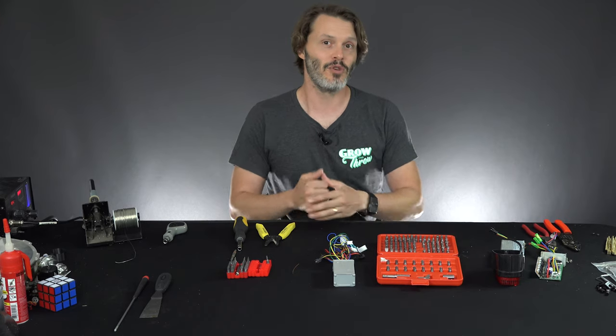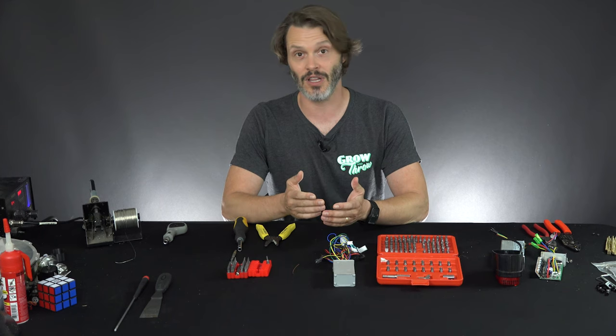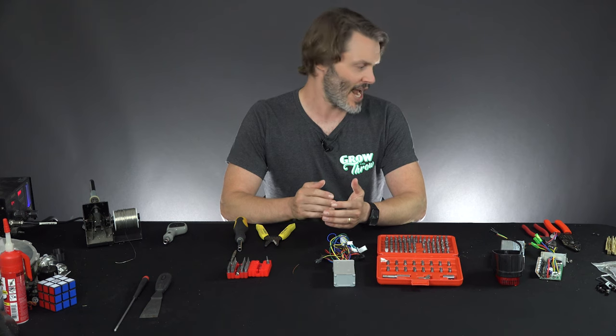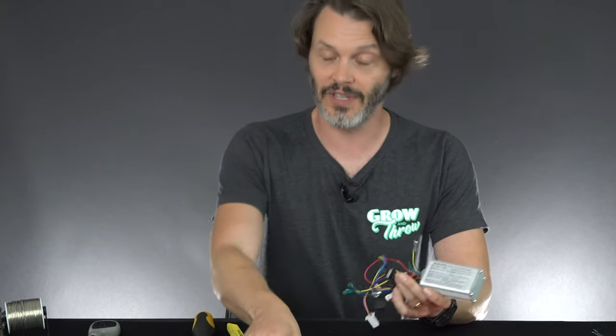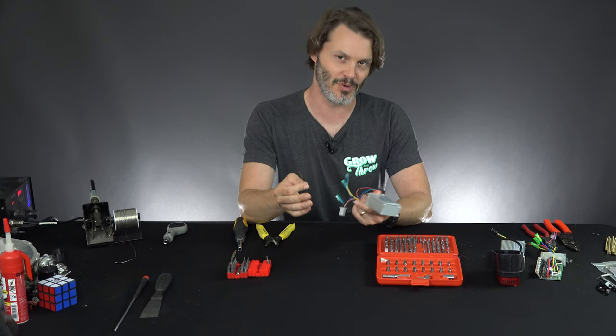But on the DYU V1, it seems obvious while riding it that it has not only a lot more top speed than the other model did on 36 volts, but it also seems to be extremely heavily amp-limited in the controller. So all we need to do is take this controller apart, hopefully find a shunt in there, and bridge over it with this copper wire. Sounds easy enough, but we'll see when we get into it.